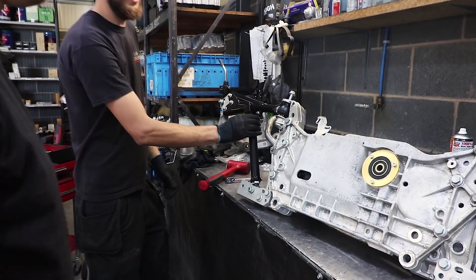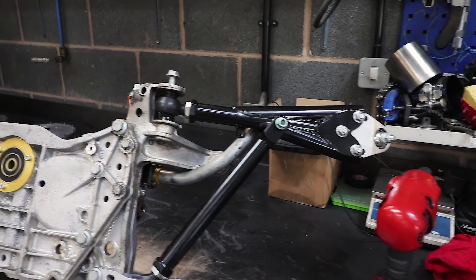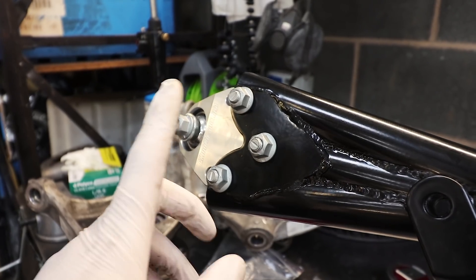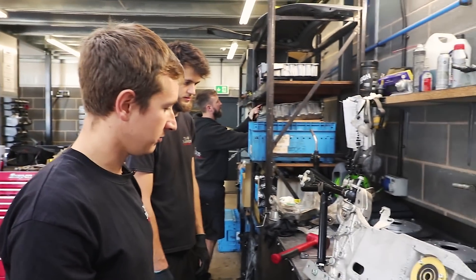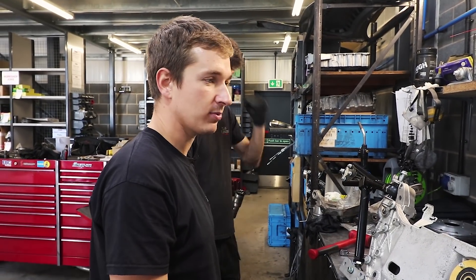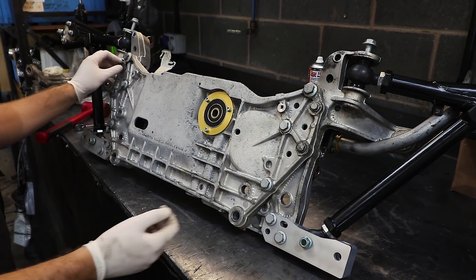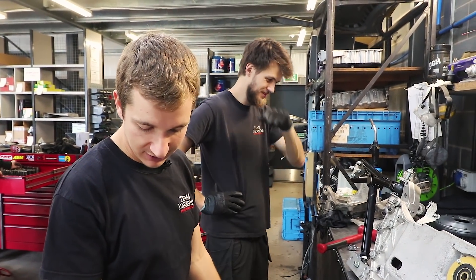How's this looking, Paul? Pretty good. To adjust it, you've got to pull that bolt out, push the arm forward, twist the arm round - that's going to be adjusting caster when we get it in the car. That one's caster, that one's camber. We've pushed these out as far as they'll go for camber. We'll probably end up leaving camber adjustment on the top mounts rather than the bottom. Hopefully we'll get plenty of caster. Dog bone bushes in, anti-roll bars on. This subframe is going to be the spare, so we're not going to spend too much time on it. Same with this steering rack - we're going to take one off a Mark 6 Golf.